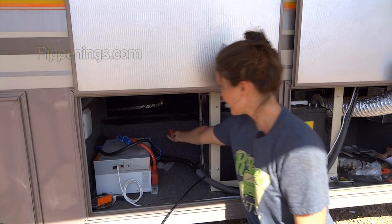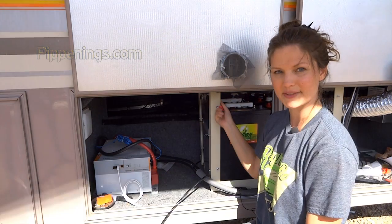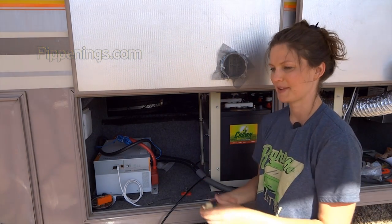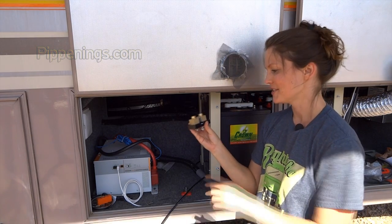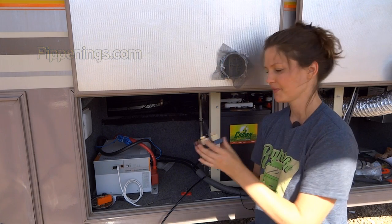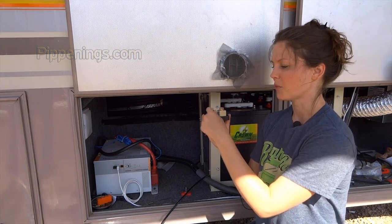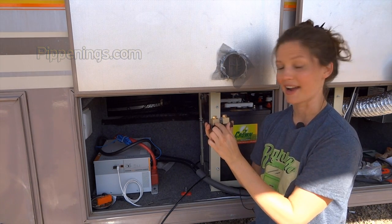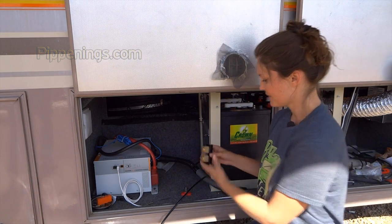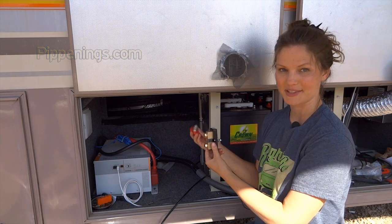That way I can have all of my cables run into an easier location than inside this enclosed cube. For the negative post, I will be using a shunt. The reason I'm using this is because I'm using a third-party monitor to monitor my voltage and it requires this. One of these will actually replace the negative side of the battery, so I need to install this in there as well. Once these guys are installed, I can start hooking up all my positive and negative cables to these terminals.